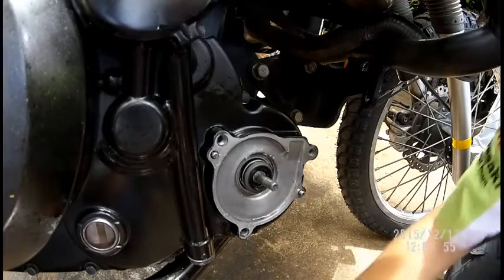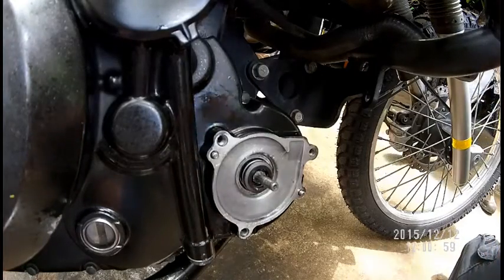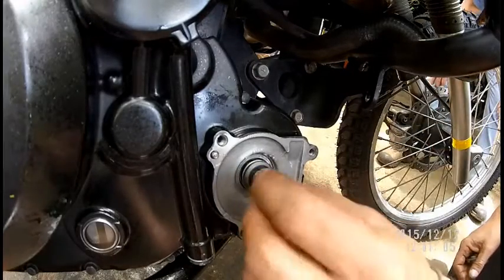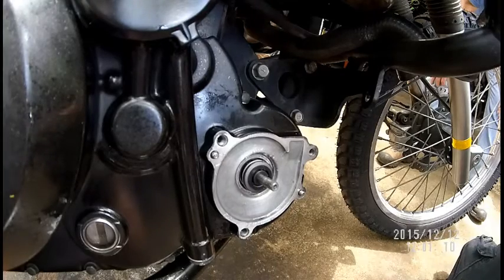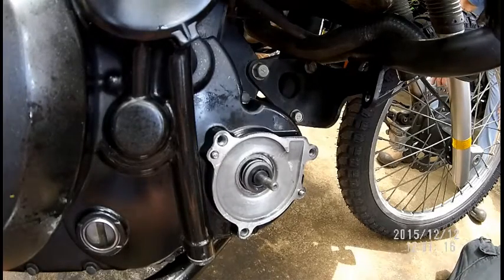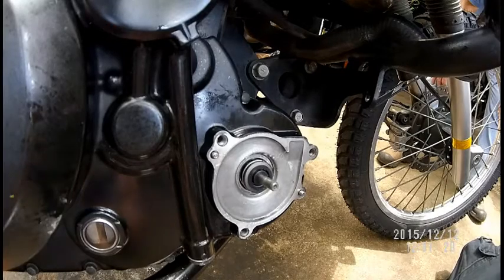Now, that shim is the most important part. Don't ever confuse it with a washer. Most important, if you leave the shim out, the pressure will actually crack that again. So put the shim on, because that gives us the shoulder. You take some fresh antifreeze, do that surface, and you put this on. Where's your antifreeze? And if you don't have antifreeze, because you're not carrying antifreeze with you? Vodka. Cokes and cold drinks aren't very good because they're obviously sugar-based.